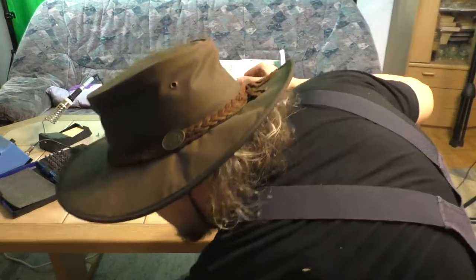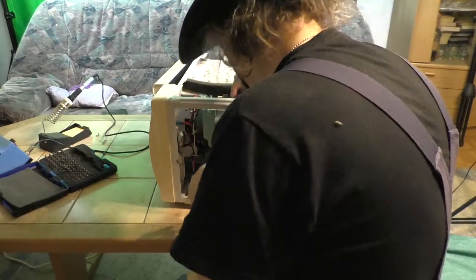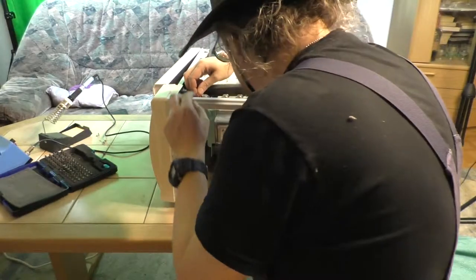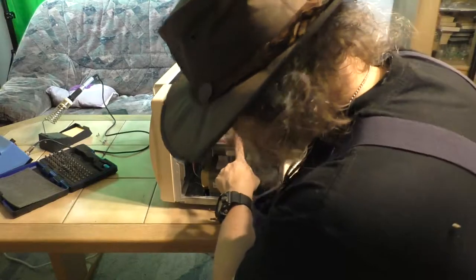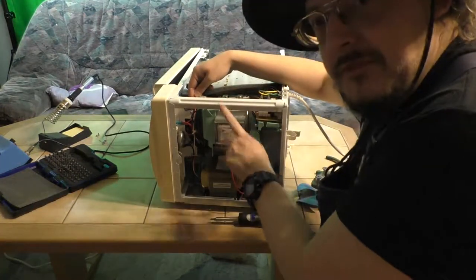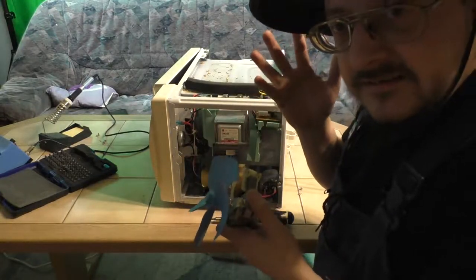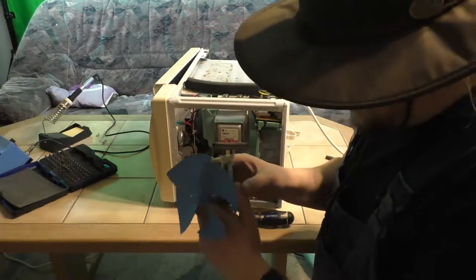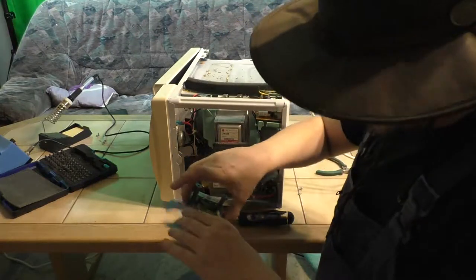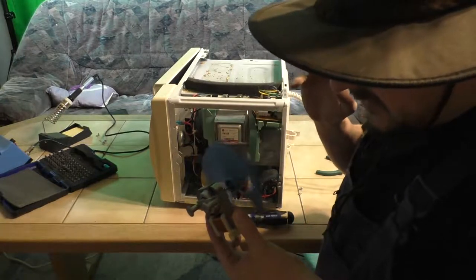I think, and I'm not sure if I understand this right, but it might be in line with the magnetron. No, it's in line or parallel with the magnetron. So okay, it's parallel to the magnetron. So every time the magnetron runs, the fan runs and cools this. And since it's a very, very fail-safe design, except when, of course, the coil has a problem, I can't imagine this dying before the magnetron. So this thing should always be cooled.